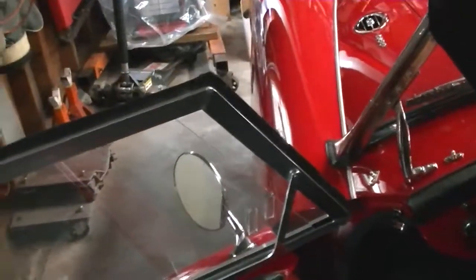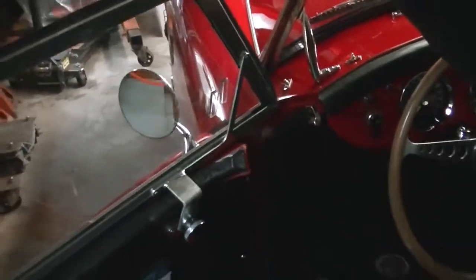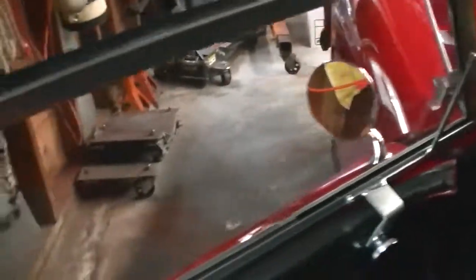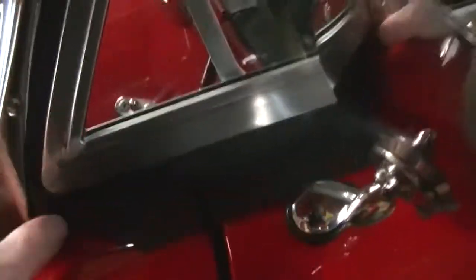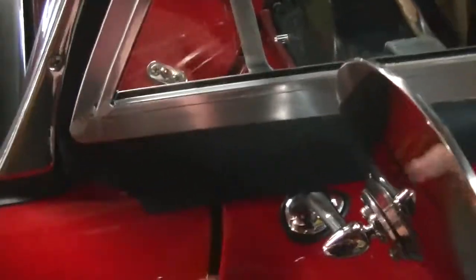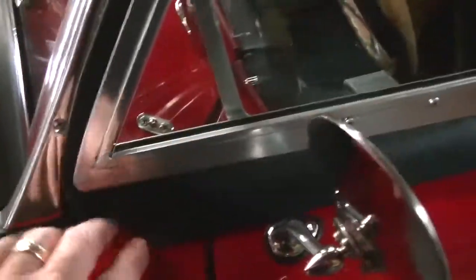You sometimes have to do a little bit of adjustment of the rubber. These particular side screens have a little bit of stiffness on the front part but not on the back — I'm actually happy with that, because I don't want the front part to open up by itself while I'm driving. I've found since I put these on that I have a very nice fit around the top, with no leaks coming in when I take a ride. Over here is where you had to do just a little bit of trimming of the rubber. If you don't trim it, it has a tendency to fall down and get caught inside the door — as their instructions say, it might follow the door. It just took a little bit of trimming. You want to make sure the rubber seals well.